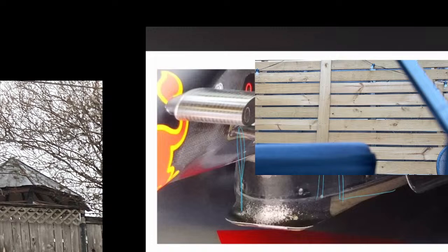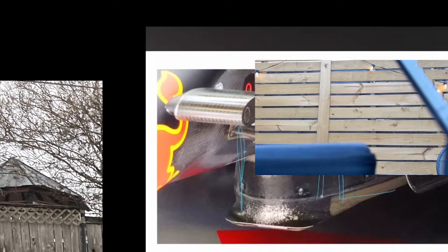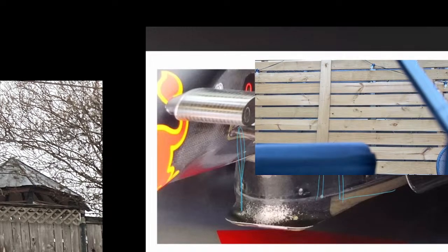that. Now, given the floor leading edge comes in somewhere around here, what this would do is that this particular blue line should have more suction around the floor leading edge with the main body, because the volume that they've got in the tunnels is physically smaller there, and it's got a better curvature distribution. So it should have more suction around that floor leading edge compared to the green line, which is more similar to what other teams run. So you would expect, back on the 3D model, that there'd be more suction in this particular region here with this design. So that's what I think they're probably getting at here.